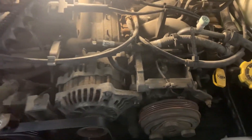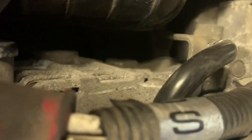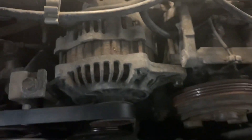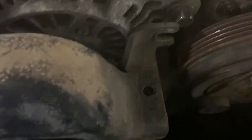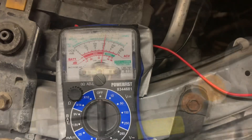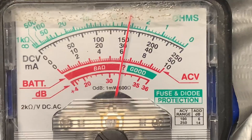We'll get this connected back up and test it again. Before you attach it, make sure you take some sandpaper and grind it down, because look at all this white powdery corrosion — that's probably what led to the alternator not grounding properly anymore. It does actually have a washer there, and this normally sits in between, so this is probably not helping as well. In my case it's the ground cable, so it's definitely worth checking yours if your battery's not charging.